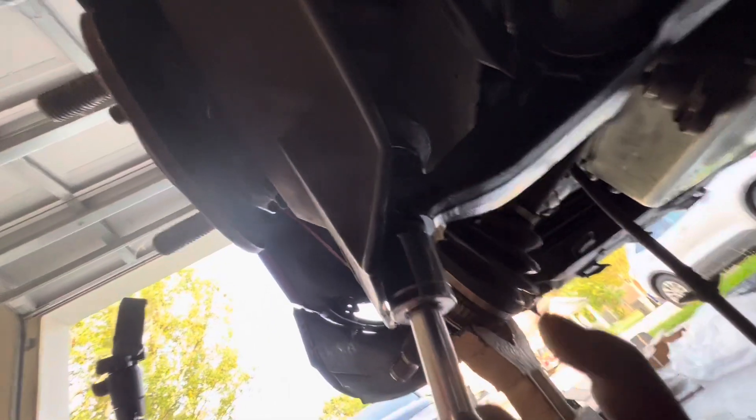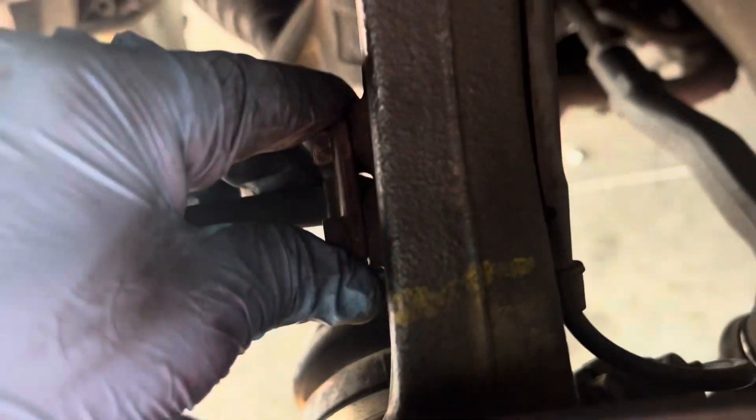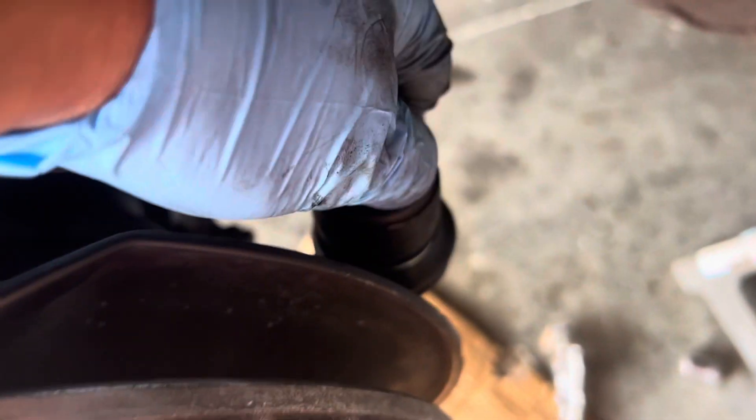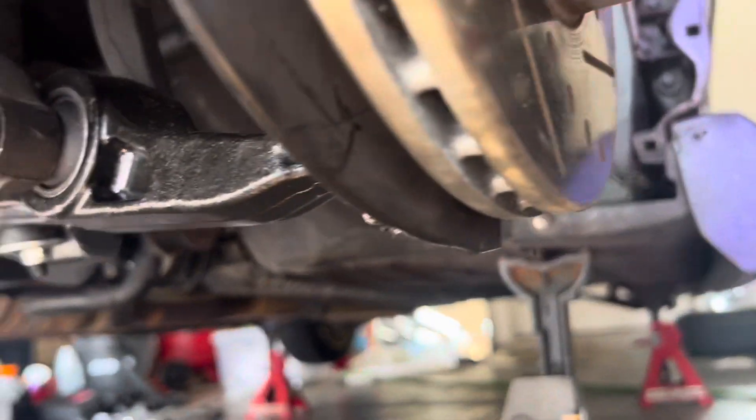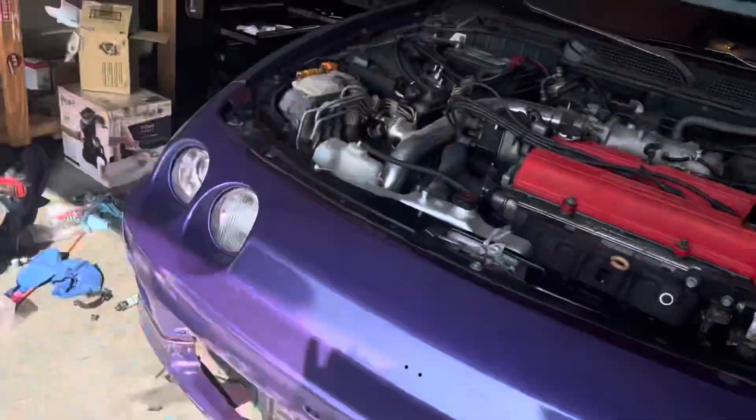It's tight now. I'm going to line up that cotter key and throw it in. We got everything hooked back up together — tightened this one, this one, and the speed sensor. Everything has been cotter-keyed and tightened up. The front's done, and we can go ahead and move over to the rears, which should be very quick — just a small thing.